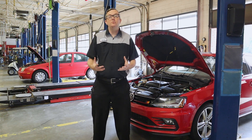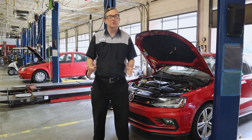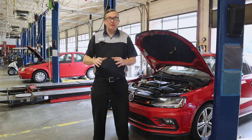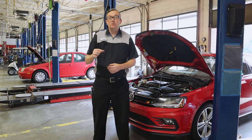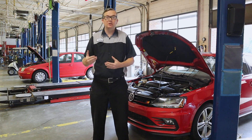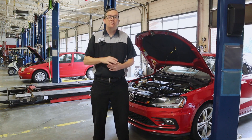I'm Mr. B and today we're talking fuses. Fuses are the most simple part of our electrical system and the good thing is they all pretty much work the same. So whether you have a Yugo or a Maybach, a fuse is going to work the same way. A fuse's job is to limit amperage. The number and color code you'll see on most of our modern fuses correspond to an amperage. Once it crosses that amperage, the fuse will blow or open up, ceasing any current flow through the circuit.